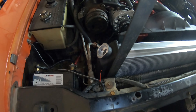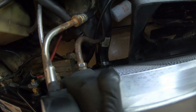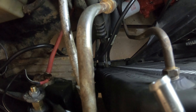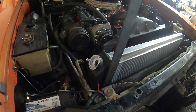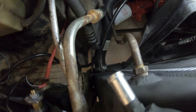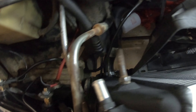I'll show you what I did — I got the transmission lines hooked up. I had to bend the top one up a little bit; it had plenty of room, a few inches. The bottom one I had to make sure was coming in straight, so look at it from all different angles. Also, take your time — keep in mind you're threading steel into aluminum. What I did was shove a piece of bar stock in the front with some towels wrapped around the bottom so I could put pressure on it without it moving. That allowed me to thread it in with the right amount of pressure. The bottom one is not as easy as you'd think; the top one was pretty easy. Now we'll fit the top plate on and start filling with water.